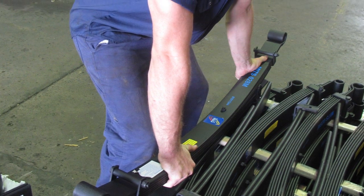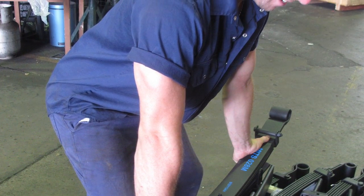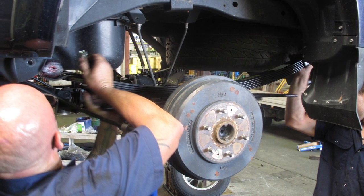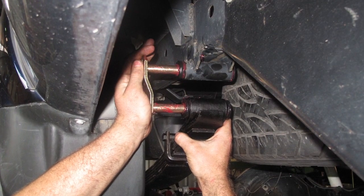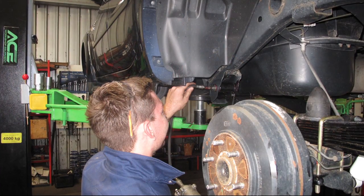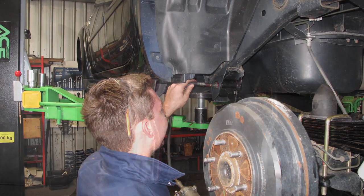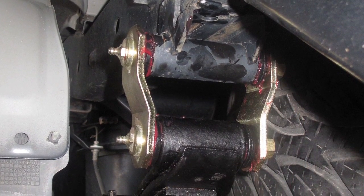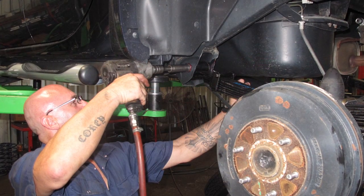Now we collect the spring chosen to suit this customer's requirements — making sure we bend at the knees when we lift, and smile. Got to have a smile when you're lifting! Lift the spring into position, pre-lube the front fixed pin and rear shackles and assemble to the spring and chassis points. Use the grease gun to ensure grease is being delivered to all the correct places on the bush surfaces. Don't overdo it and leave a mess, as excess grease will eventually drop on the driveway or road. Tighten all U-bolts to correct tension and re-check that pins and shackles are tight.